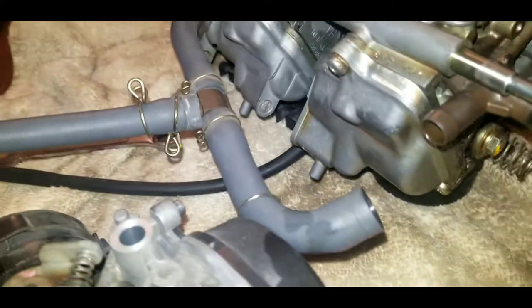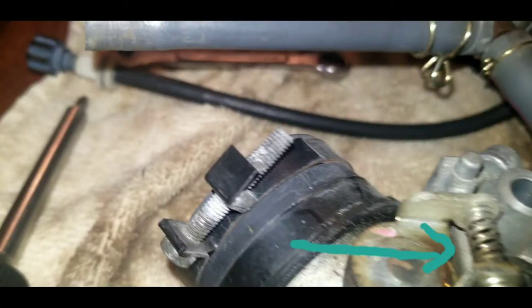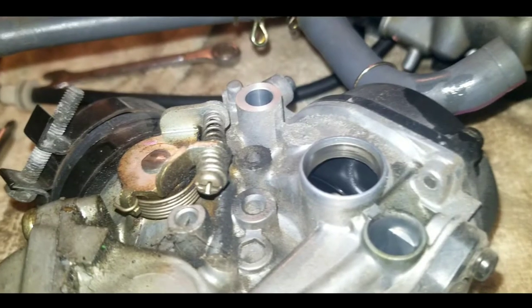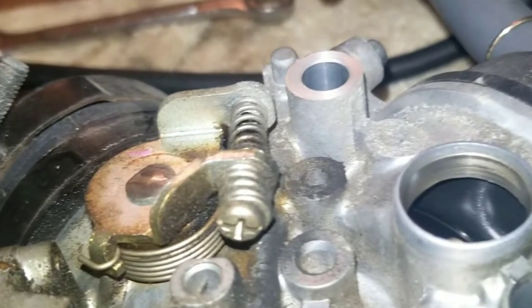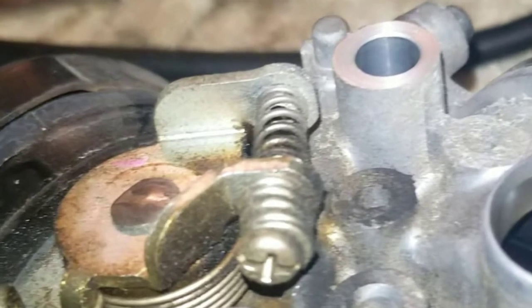The trickiest part is the throttle springs that go on the little tabs that you use to balance the carburetors. Pay attention here because you're going to have to remove this spring once you get the carburetor separated — that's because the connecting arm from the next-door carburetor goes in between these two tabs and you can't put it in place while that spring is sitting there. You need to pull it out, push the carburetors back together, and once they're together reinsert the spring.